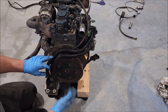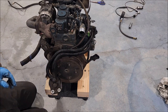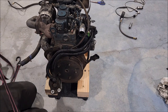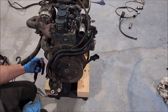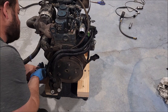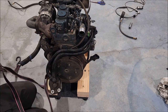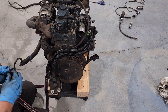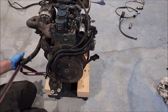And that's not something that they really sell for this motor. I'm sure there's some custom application somewhere where they made that for somebody. I don't have it. I have this nearly useless pulley on it. If it was a normal pulley, like a normal size, with some type of gear reduction ability, it'd be fine. But as it sits, it's just a big, big pulley. So you would need to run it to a smaller pulley, which might be going too fast. Usually you want some gear reduction there, so I don't think it's an ideal setup for anything I could see myself using it for.